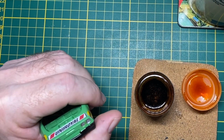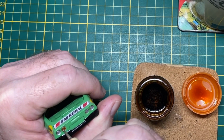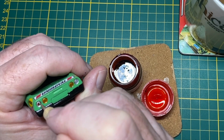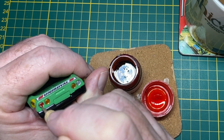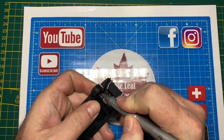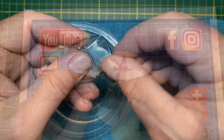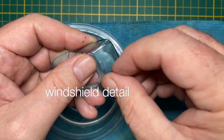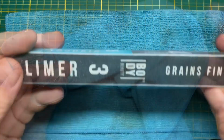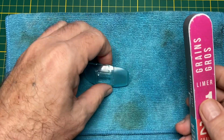The C4 was produced by Chevrolet from '83 to '96 with assembly at the Corvette plant in Bowling Green, Kentucky. General Motors had acquired Group Lotus, a UK-based performance car manufacturing firm, in 1986, and the Corvette division approached Lotus with the idea of developing the world's fastest production car to be based on the C4 platform of the Corvette. With input from GM, Lotus designed a new engine dubbed the LT5, which was an aluminum block V8 with 4 overhead camshafts and 32 valves, producing 375 horsepower in the ZR1 model.